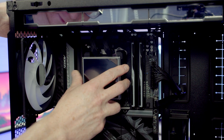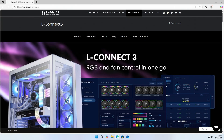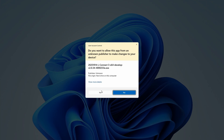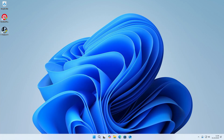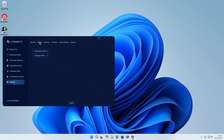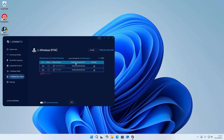Replace the screen, remove its plastic protection, and plug the wireless controller into a motherboard USB port. Download Lian Li's L-Connect — there's a link in the description. Run the installer, click through Next, Install, and Close, then open L-Connect 3 and click Yes. On the first screen you'll see all your system information. Go to Settings, then Device, click on Wireless Sync, click OK, and set up wireless devices. Bind the devices to the wireless controller by clicking Link, then Lock Bound Devices, and OK.